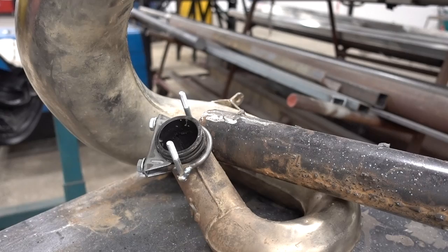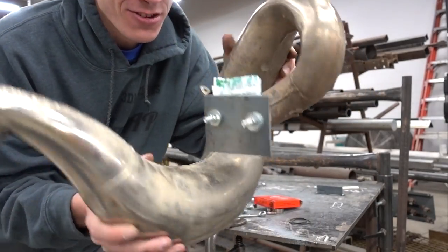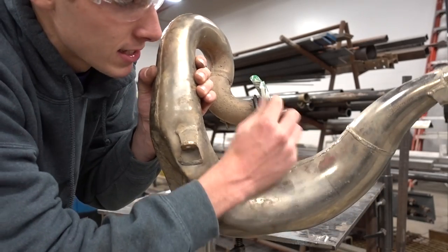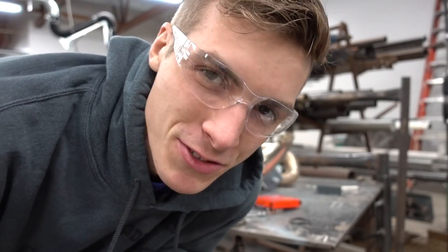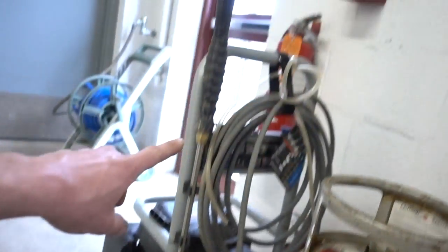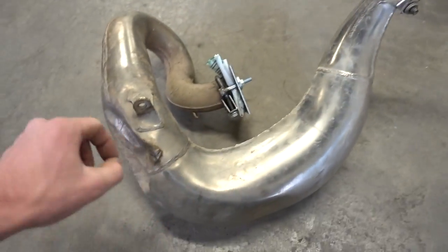We're making progress, I think it'll work. This is like rocket science. So I came up with this rig — I have that clamp welded to two bolts, then a piece of plate we cut out and punched two holes in. I'm not sure if this plastic stuff is going to work, but I've never done anything like this before so we'll try. We're not gonna fail — we only get results. All I have to do now is take my pressure washer, hook this end of the gun up to this end of the hose, clamp that down, and just let it rip. Hopefully it pulls these dents out. I saw a couple videos on YouTube — that doesn't mean it's going to work, but we will try it.